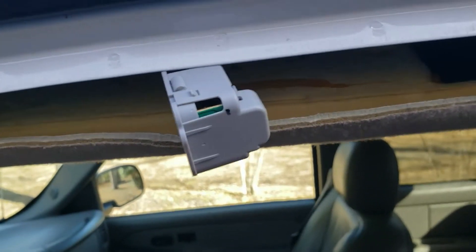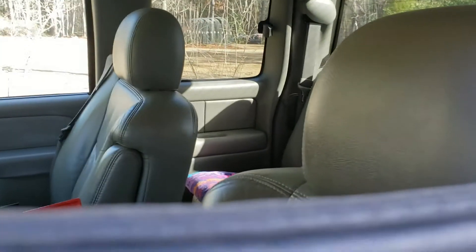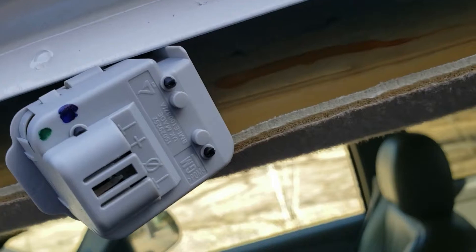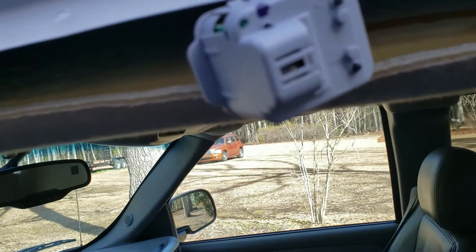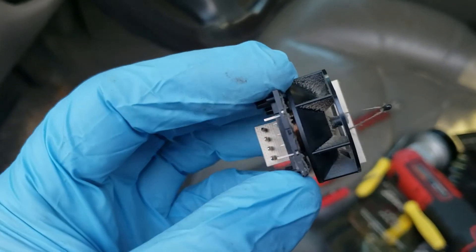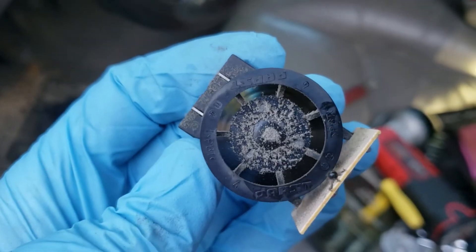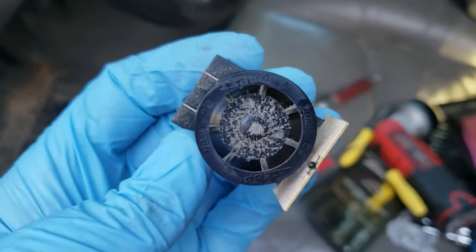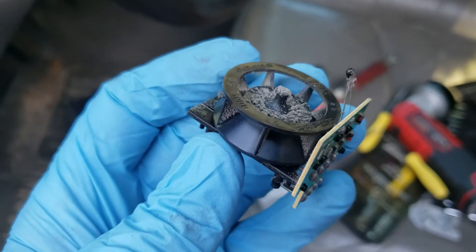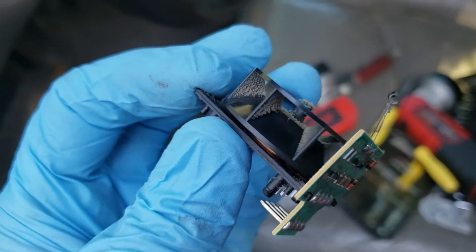Here I am about to slide this thing out of the hole — it's a bit of a pain in the rear. You've got to work with picks to get in there and lift the tab to pull the wires loose. It's tight working, but it ain't that bad. I took this thing apart expecting to find a loose bushing in the motor, but it feels perfectly snug. So I'm going to take it inside, hook some air up to it, blow it out and get it cleaned out — it might have had something making it slightly out of balance and causing a noise.